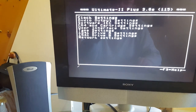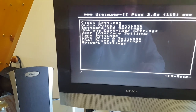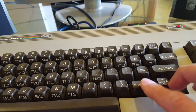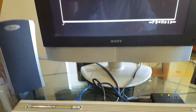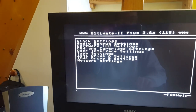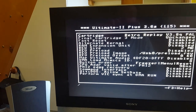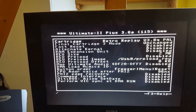Now, we want to go to the corresponding menu to set up the cartridge settings, which is C64 and cartridge settings. Press return there. Use the cursor keys to go up and down. So shift and the cursor key to go up, and then just the cursor key to go down, and left and right. I'll show you that in a bit more detail later. In C64 and cartridge settings, it's that top item we want, the cartridge. It's currently on the Retro Replay version 3. Press return there,